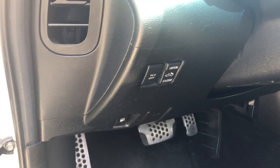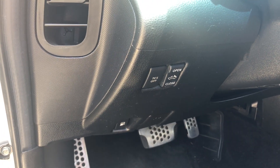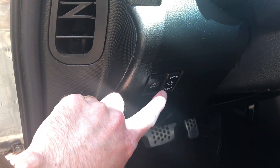If you have a problem where either your brake lights don't work, your top won't go down, your cruise control won't disengage, or your brakes are just locked up and totally won't move at all — there's no movement in your pedal — there's one solution, maybe two, that might fix any of these issues for you. I'm going to show you what I did, what I did wrong, and how to do it right. So assuming you have the car started and you have your foot on the brake pedal, and you push this button to put your top down or up, and it doesn't do anything, the problem probably isn't this switch here.